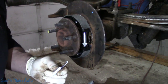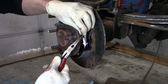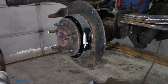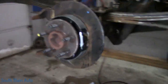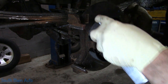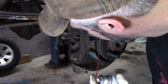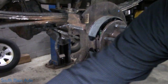Last but not least, the white spring. Hook it on the bottom first, hook it on the top — it really doesn't matter, as long as it's hooked together when you're done. Then we'll make sure our shoes are sitting about equal on the pads. I like to put a little bit of fluid film in the actuator just to keep it from seizing up. Give her a little toot right down inside of it, a little bit up there — make sure it gets on the pivot. Don't go wild with this. Then we can give her the classic reach around here and pull the cable.